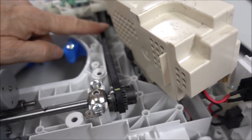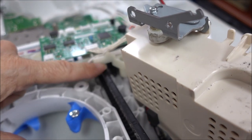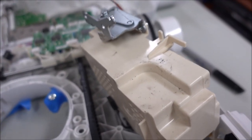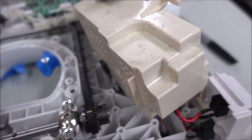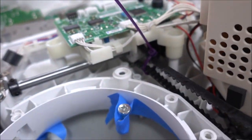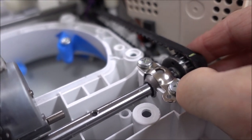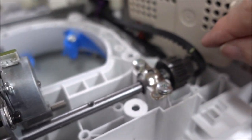That harness is completely out of the way. I have not upset anything with the gear or the timing or moved anything. The timing between these two shafts has to stay where it is, so I'm going to be very careful. I'll slip a tie wrap on the belt so it doesn't slip off the top shaft. I'm not going to turn this mechanism at all. I'm going to slip the belt off this end, and when I put it back together I'll align these two marks.